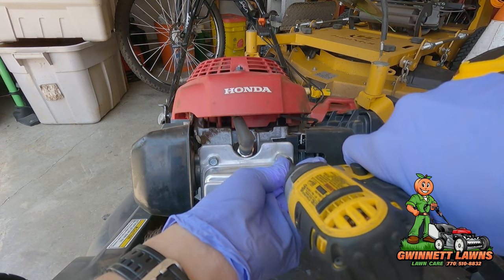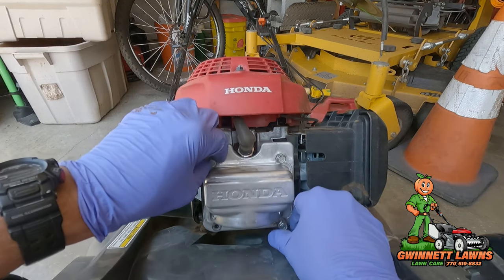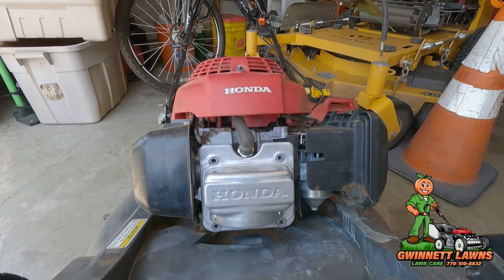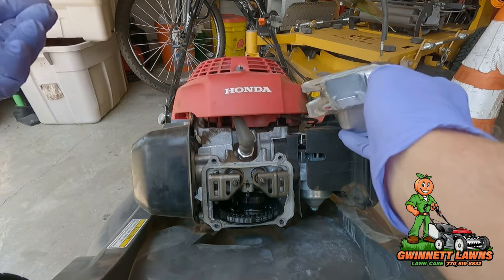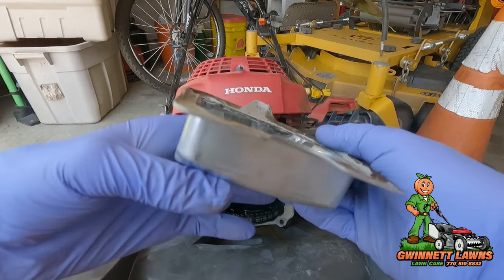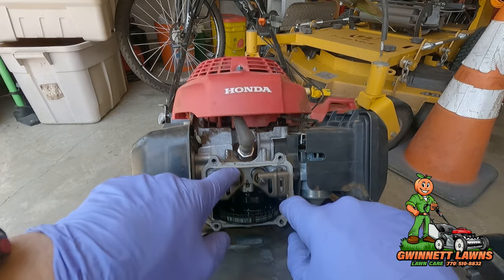If you want to know more about the problem, search my channel — I also replaced the rocker arm and it's very easy. This problem is more of an annoyance than a difficulty. So this is just 10-millimeter screws or bolts, and this is the valve cover. I have taken this on and off a couple of times and it didn't leak at all. I'm going to show you how to make a gasket for this so we can get rid of the Honda bond or RTV, because normally when you take these off you have to pry them off and they end up bending.